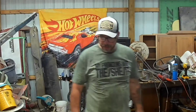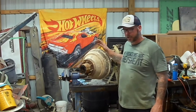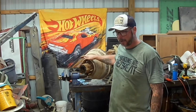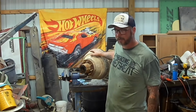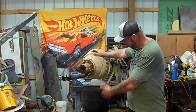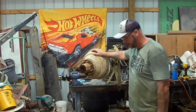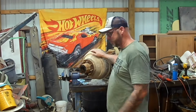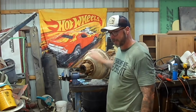So after I picked it up with the cherry picker and put it on the bench this way, knowing full well if it fought me at all that I wouldn't have room to work, I fought with it, and then picked it up with the cherry picker again, got angry and pulled on the bench and broke the jacks that I put on the bottom of it off. I threw all the metal stuff that was under the bench out of the way so that the cherry picker would work better. And then I got it set on here this way so I had room to work right in here. And then after only 3 pulls of the slide hammer, what do you know, the axle came out the way it was supposed to.